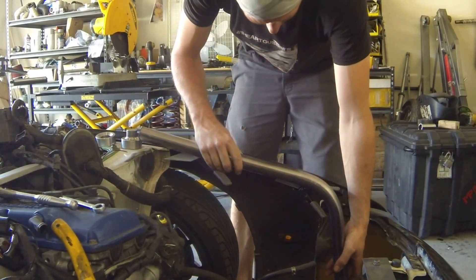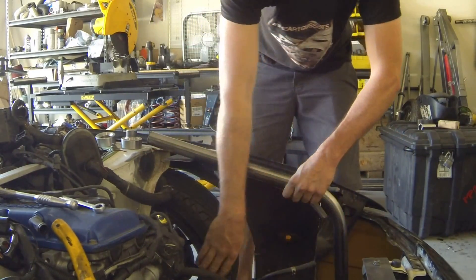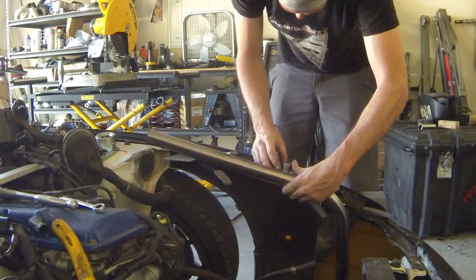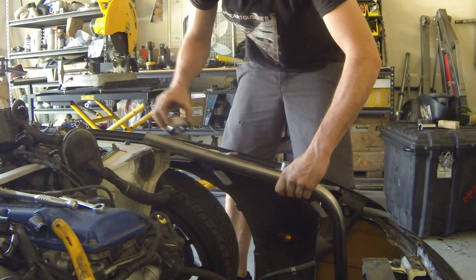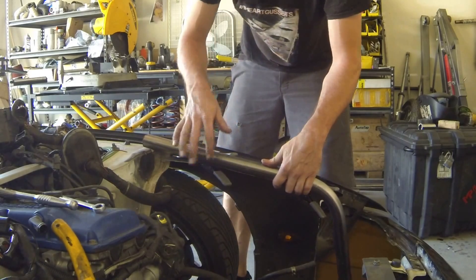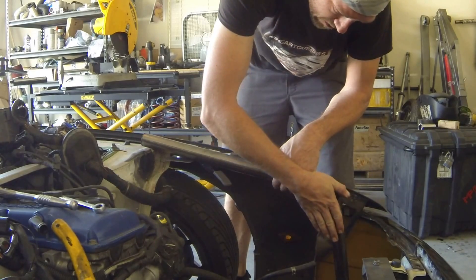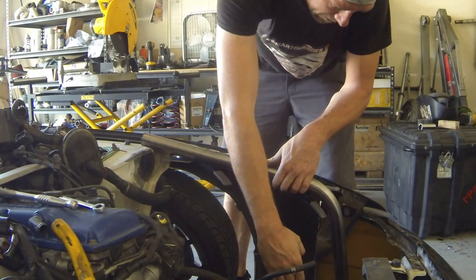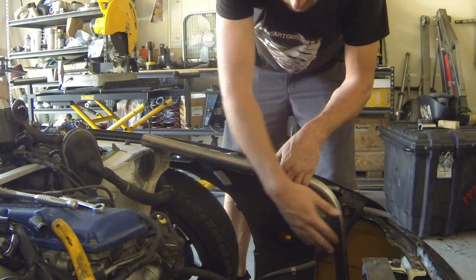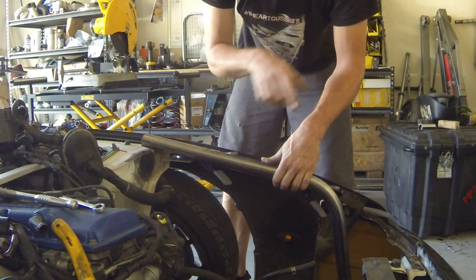Let's run this one again. Right now I just need to get my height measurement or distance to determine where to cut off the chassis rail — I'll switch angles in just a moment to show you that. I'm going to place my dimple dies right in between the tube as a good guide and spacing measurement. I want to make sure this tube is parallel with the side of the chassis rail, which will help me determine the point and angle at which I need to cut the end of the tube. Let me switch angles real quick and show you that.